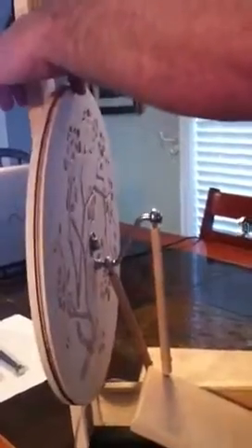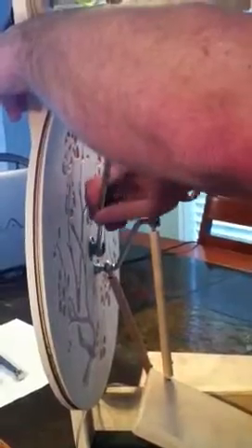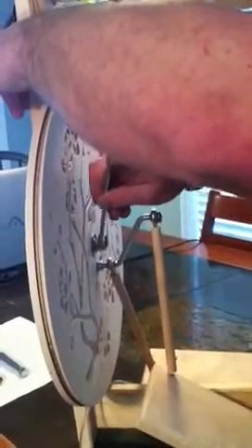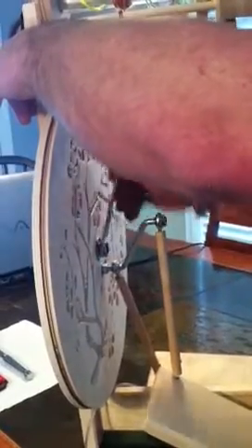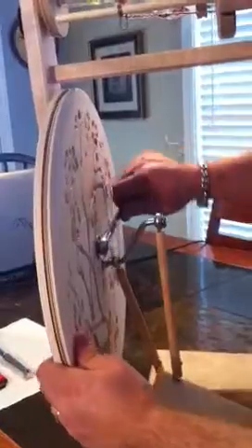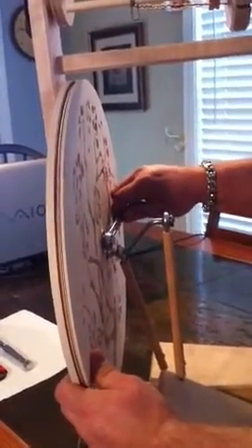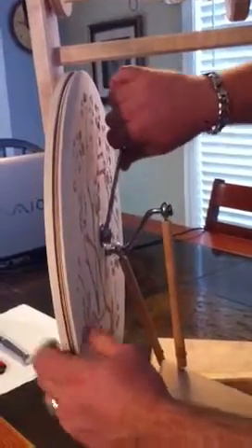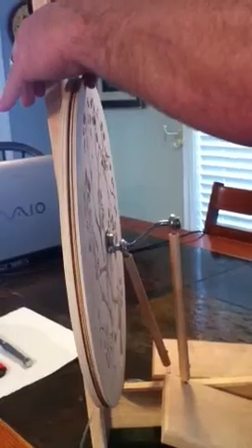Notice if it's not tight enough — that's too loose. Once the bolt is tight, give it about a quarter of a turn or an eighth of a turn until all the play is gone.